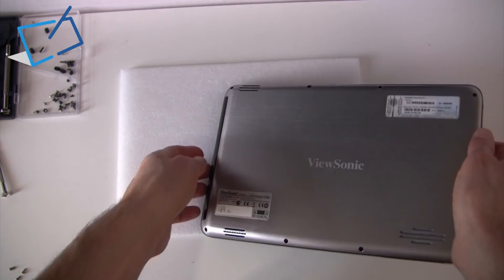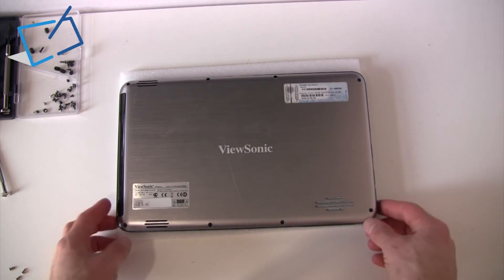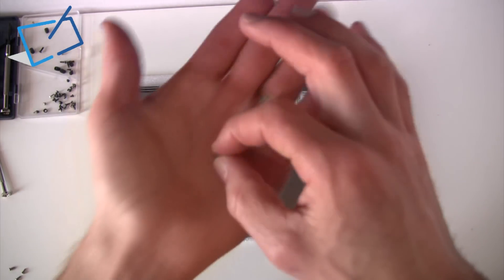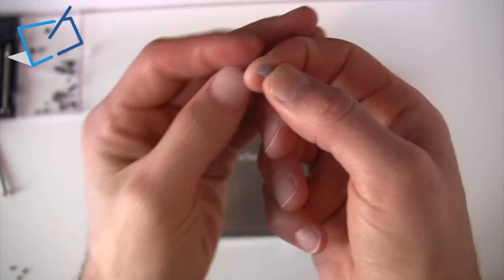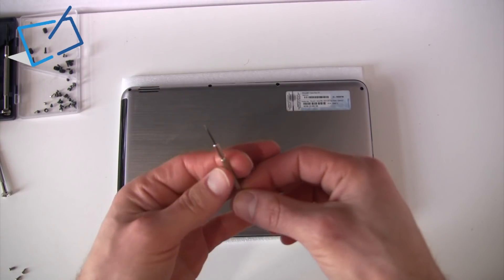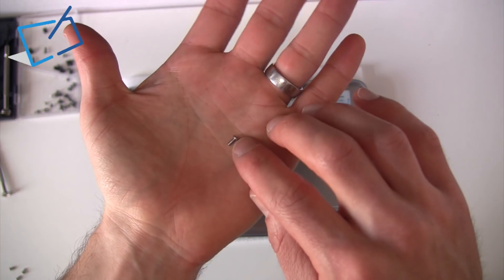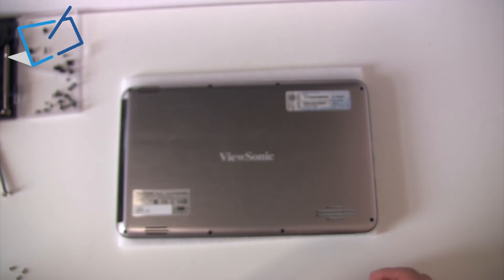We've already made our way into the device. There are four screws along the top and four along the bottom holding the metal back casing to the front housing, and they are all covered with little plastic stoppers. You need to lift those out with a very fine tipped screwdriver, then use a Phillips screwdriver to take out the eight screws. They're not put in by machine and should come out pretty easily. Put your eight screws aside.